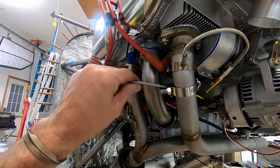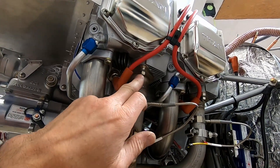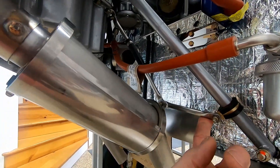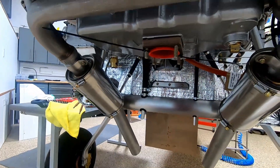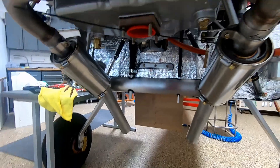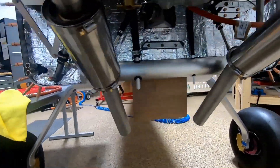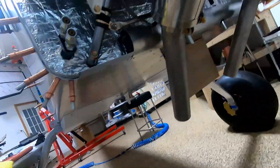I would say that's a productive day. Got all the sensors, the oil injectors mounted, got the exhaust on. I don't have anti-seize on there yet — I ordered some, I got it coming — so these are just a little snug. Got all of these brackets figured out. This is the one I was talking about that I kind of just made solid — that's working out pretty good. Remember earlier when I was saying these two are not symmetrical? I think they take into consideration that this one sits back further than this one and they actually bend it at a steeper angle. Right now I did spread them apart a little bit more — I think there's like ten and a half inches or something. The angle looks the same from here, and this one is a little steeper for the reasons I just said. Also got this all riveted in.